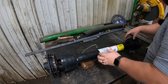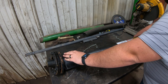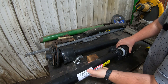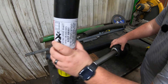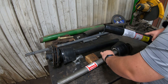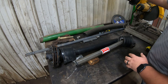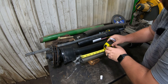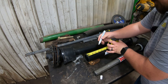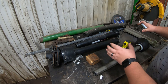Now split the drive line, and when you do, take the plastic shielding off as well. This one has three screws holding the shield. You want to make sure and cut 4.5 inches off the plastic and 4.5 inches off the actual shaft, then put everything back together. Once we have the piece off, go ahead and mark 4.5 inches on both the shaft and the plastic. Then take it over to the chop saw and make those cuts.